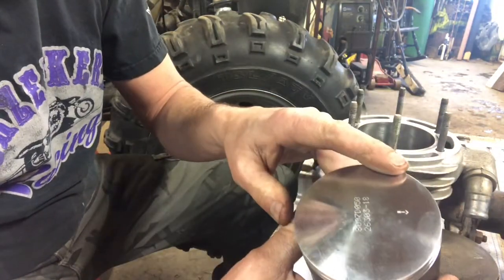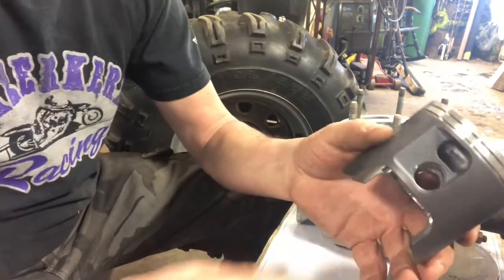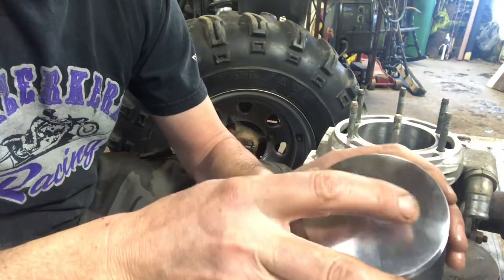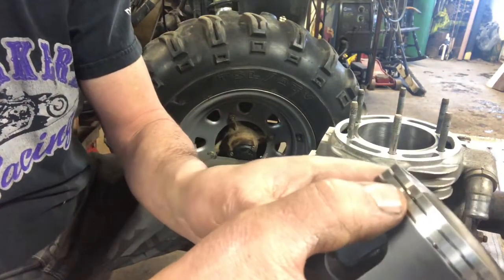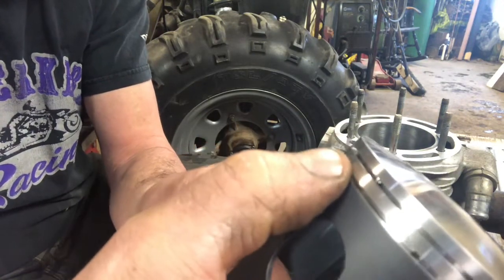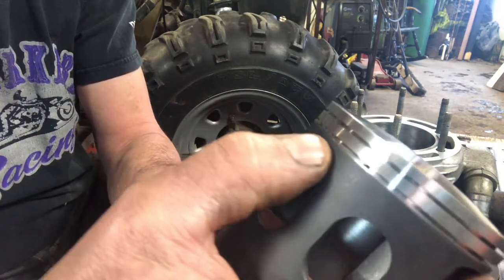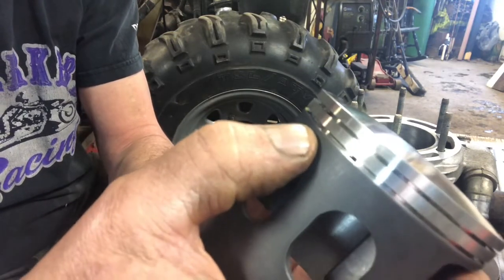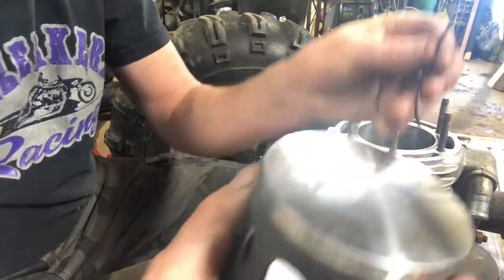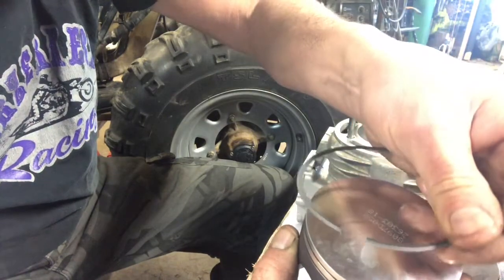Here's the reasoning for which way the arrow should be — and has to be — in your engine, and it involves exhaust ports in the cylinder. So this piston is facing forward to our exhaust, and that's because there are little dowel pins in here — a little hard to see. There's little piston ring lock pins in here, and these make sure the rings are lined up away from any ports or open areas in the cylinder, which basically keeps your ring gap away from any openings. That's the reason for those.